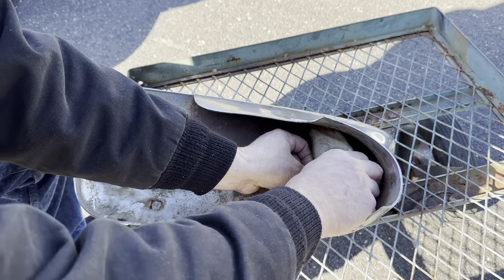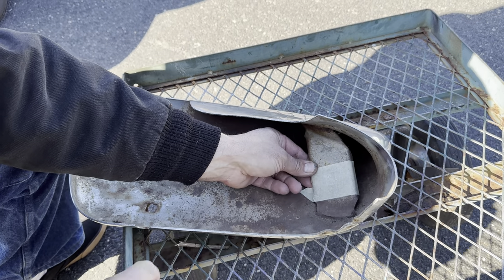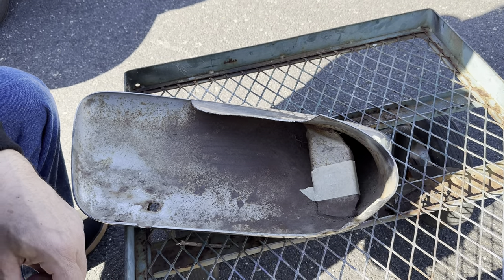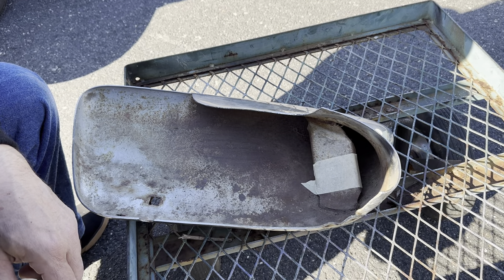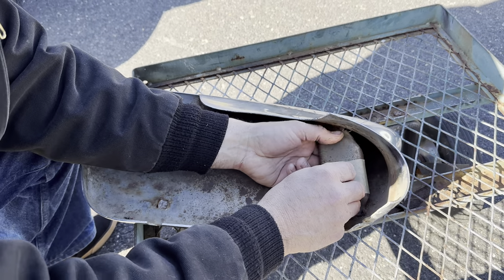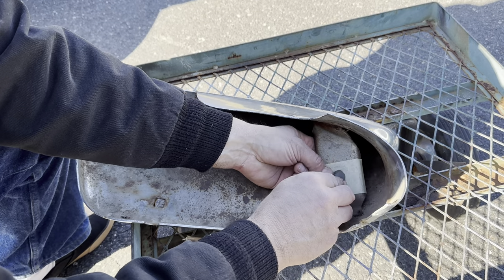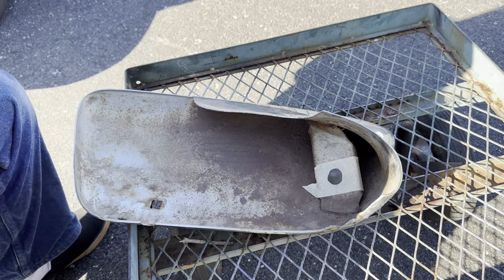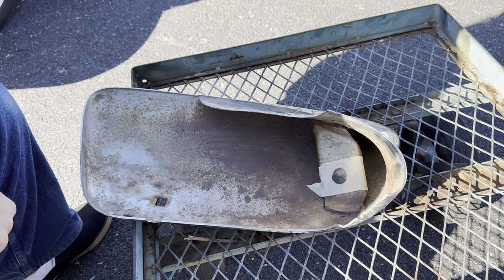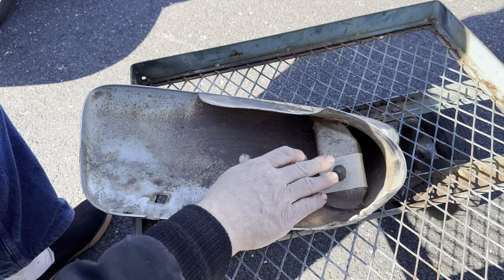What I do is take a wide masking tape and set it over the bolt opening so you have a closed platform and you can see the square. Then you take something like duct seal — which is a plumber's putty — or butyl seal used around windows or on campers, and set a little putty ball dead center of where the carriage bolt would be installed in the wing. Make it into a little point, about a half inch tall.